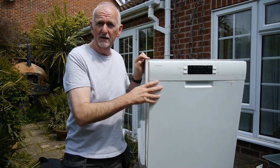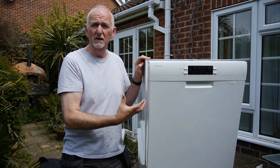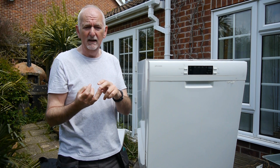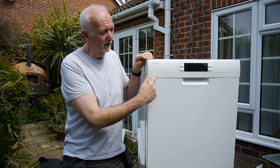In today's video I'm going to show you how to repair a dishwasher that's not washing properly because the water's not heating up. I've not done this before but I'm thinking it can't be that hard. Water's coming in, water's coming out, the element's going round, it's going through the programs — the only thing that's not happening is it's not heating the water. So straight away you think it must be the heater element, or if not, the thermostat or the PCB.